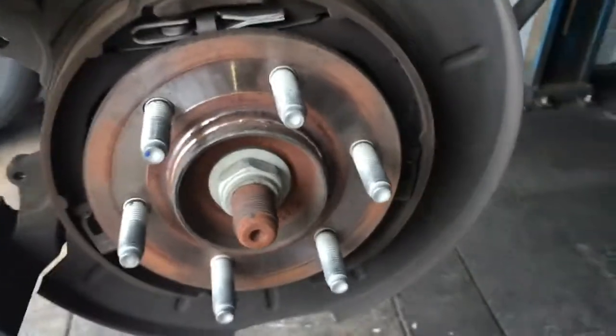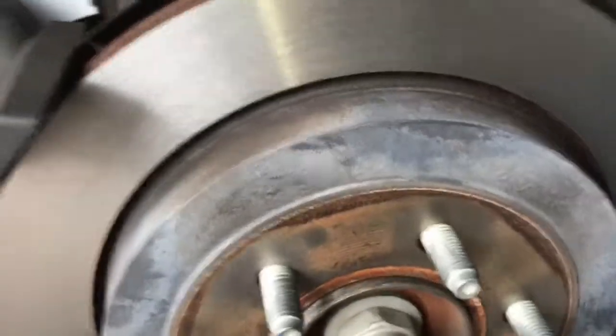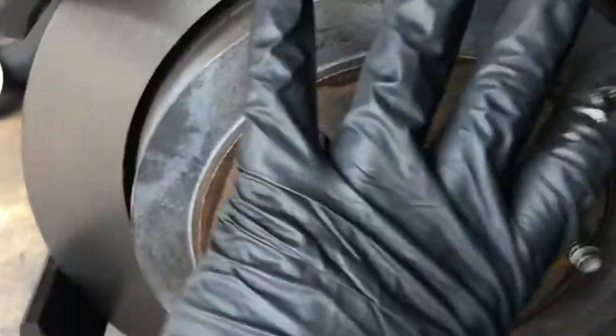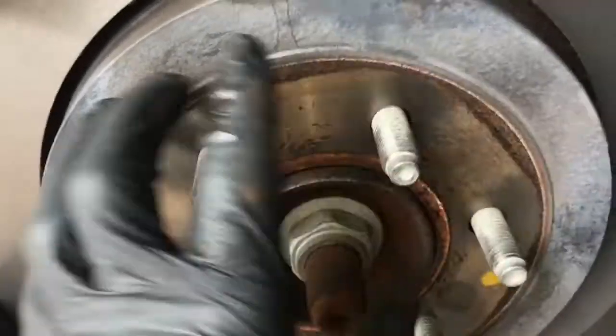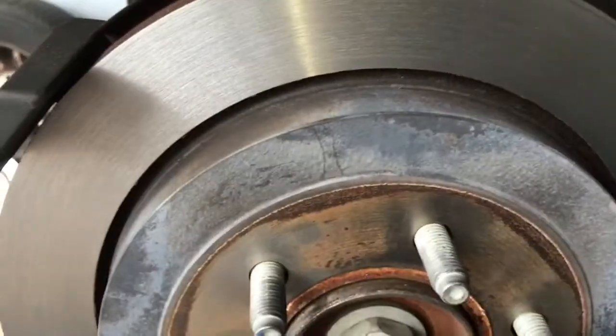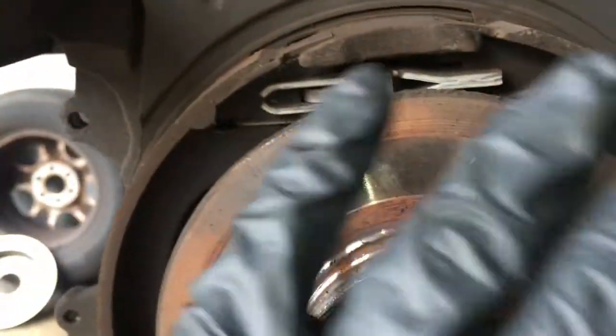Now that your brake pads are prepped, we're going to install the rotor back on and check the park brake adjustment. Slide your rotor over — and as you can see how loose this is, that indicates the park brake is out of adjustment. You want to feel a light drag on the shoes on the inside. If it's loose like this one, pull the rotor back off. On the bottom of the brake shoes there's a little adjustment wheel — adjust it a couple clicks, slide your rotor back on and feel it. Do small increments at a time until you get a snug little fit.